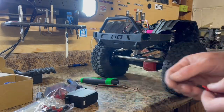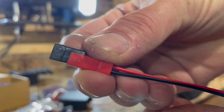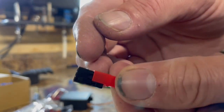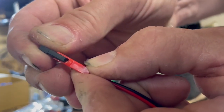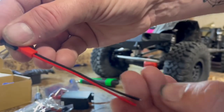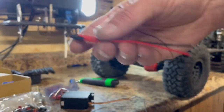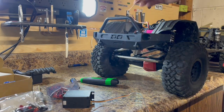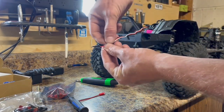To make the connection from the servo directly to the battery, I had this old servo laying around. I removed it and I'm going to pop the wires out of the steering servo that's on there and put them in this guy. I cut the JST off and made it so you can fit the two prongs — your negative and positive — in there on the servo. Then I'm going to put a Dean's plug on the end of this so it plugs directly into the battery. This end on the servo will have the signal wire only and will plug back into the receiver. We have some soldering to do — we'll continue on.